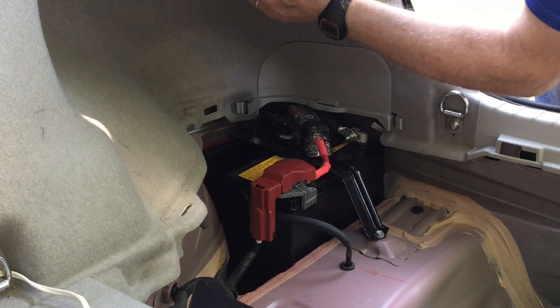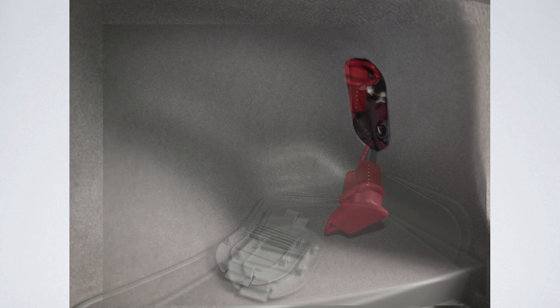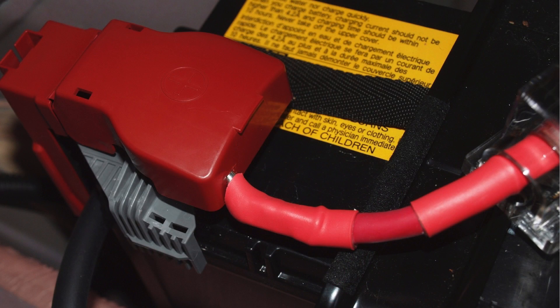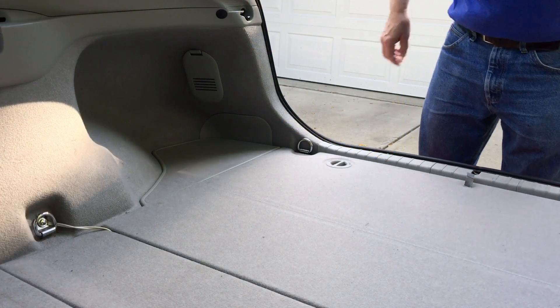It's very nice — you just have that Anderson connector hiding in the little space there for your stoplight port. Make sure that when you do this you leave a loop so that you can grab it. You're going to need to cut a little notch in the positive red cover so that the cable will fit out — here's how I did it.